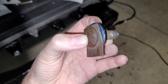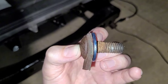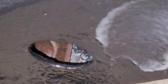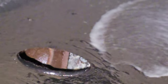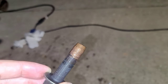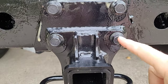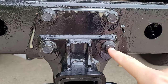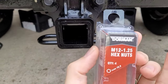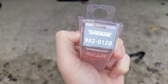I've decided to reuse these bolts from the previous installation because the two bottom captured nuts have come out. On the bottom, I'm using a 5/8-inch grade eight washer. There's that bolt fed in through the top of the frame along with the washer. On these screws, I've added a little bit of anti-seize. The nuts on the backside are a little too rusted for my taste, so I bought a couple of M12 by 1.25 hex nuts — these are grade 10.9, part number 982-012D.